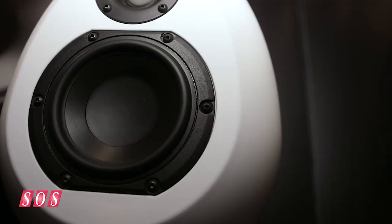The drivers on the 100 system are 100 millimetres — or in English, four-inch drivers — but they pack a hell of a lot of punch. It's a very loud system. We've also redesigned the stand: the new 150s will come with this new egg-cup type stand as well. The benefit is that it lowers the speaker onto the flat surface, so especially for the 100 as desktop speakers, you get about an extra 3 dB of lift on the bass.